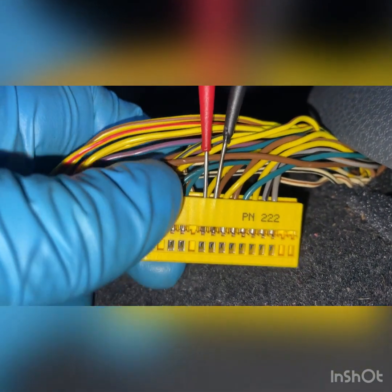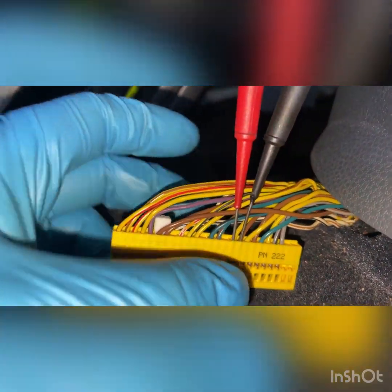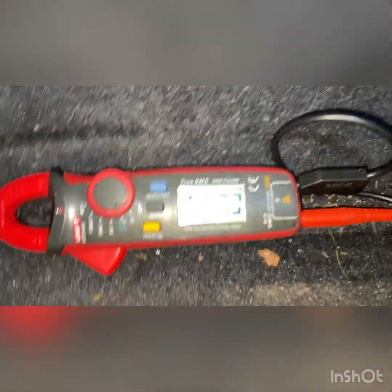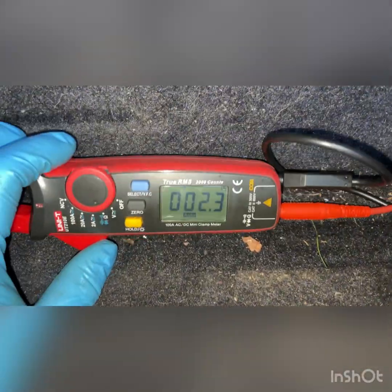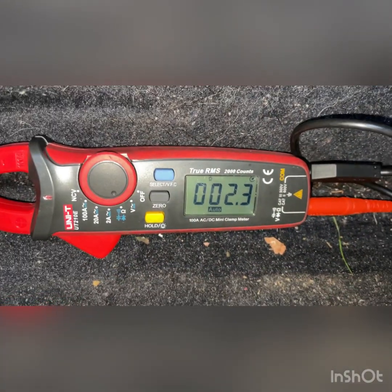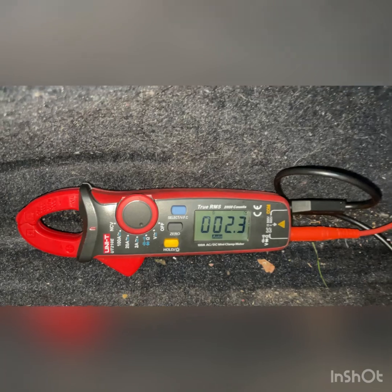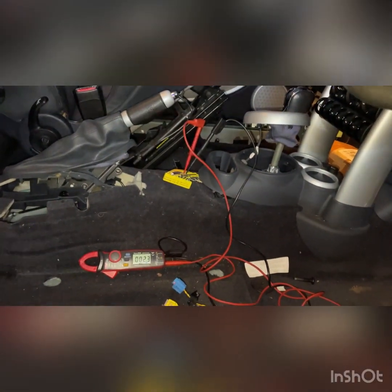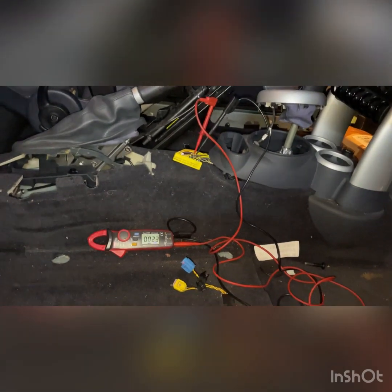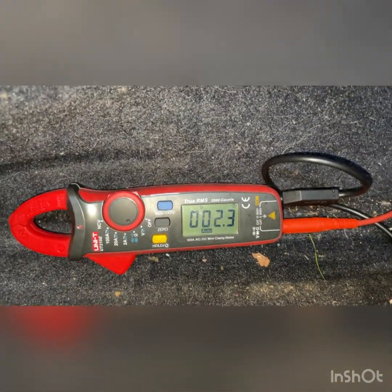And then we've got these two. So just back probing again to get the resistance of that airbag. And look, it's the same reading. So I always like to think our airbags are roughly about the same on the car, so between 2 to 5 ohms. So we were okay there. So again, that circuit, so that's two circuits we checked now that are okay. So we will condemn the airbag control module on this car. We get a replacement. Let's see if we can get this fixed.